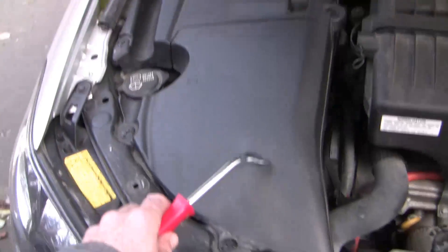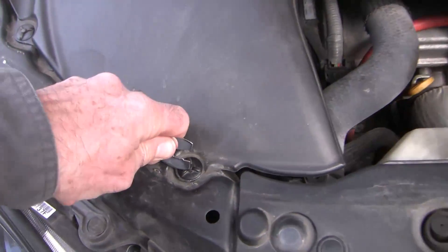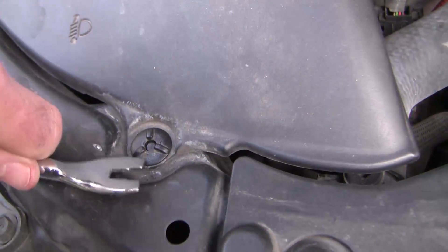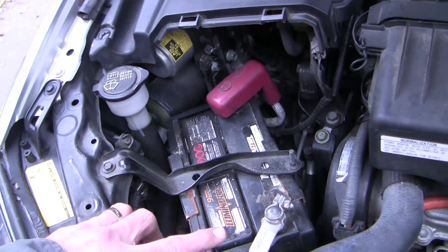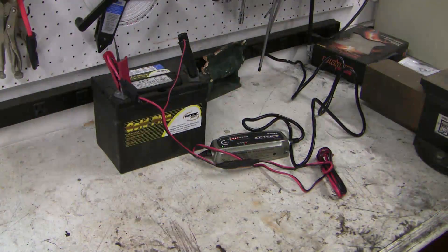To get at the accessory battery, you need to remove this cover plate. Take off this plastic tab and this plastic tab — press in the little centerpiece and then pry up on the tab. After exposing the battery, I tested static voltage which measured 10.5 volts, and then I asked her to turn the start key and my multimeter dropped to 9.1 volts across the poles. I boosted the battery and she was on her way. That nicely proved the battery was inadequately charged, but it does not prove the battery was bad. Formal battery testing requires a load test after checking electrolyte levels and a full recharge, but what I did at the roadside was enough to get the vehicle back on the road.